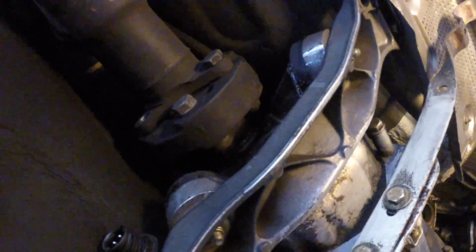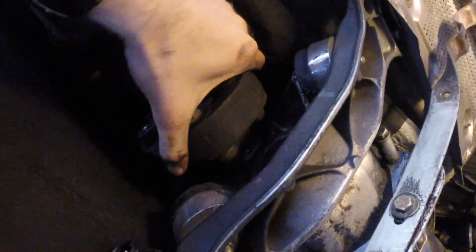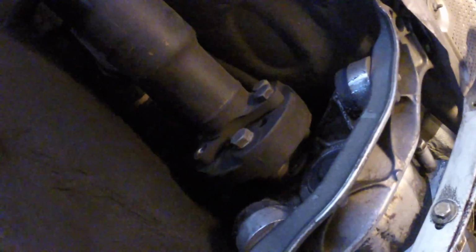parking brake's off. So I gotta take out, I think I'm gonna do just these three because my Guibo actually looks like it's in pretty good shape. This is your Guibo here. This thing, when it's dying, it can introduce some pretty crazy drive shaft vibrations. So I'm gonna take the other three off connected to this. Then the middle here, and I don't know what I need to do back there to slide it out, but we might just get to stop there.